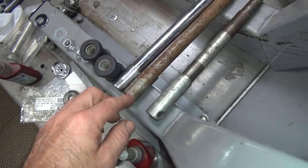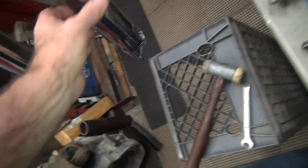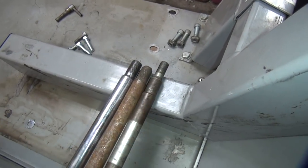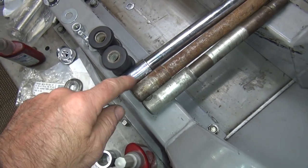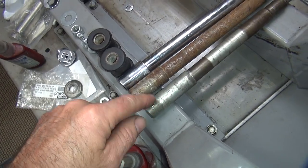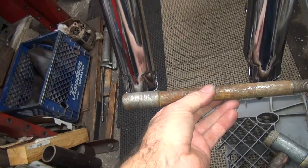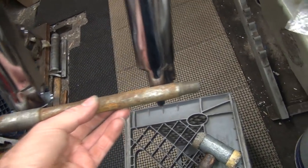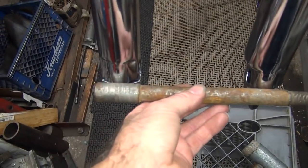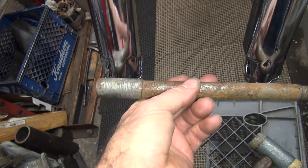So this one here has the correct large hole size all the way across, we need here. 3/4 inch. This one's neck down here, so it's different. But what is different is this is actually smaller diameter than these two on the shank, so it fits the fork, which is kind of weird. So this one here is the correct length. It gives me support in the axle. The threads don't come out the other side, or the shoulder doesn't come out the side of the axle. And this shoulder here will just peek out of here, so it'll just fit in like it's supposed to.